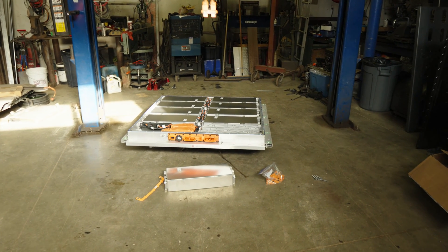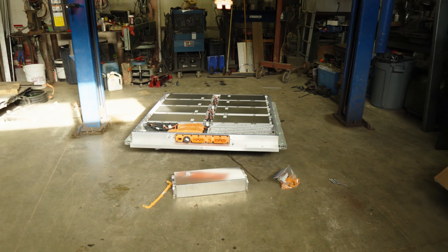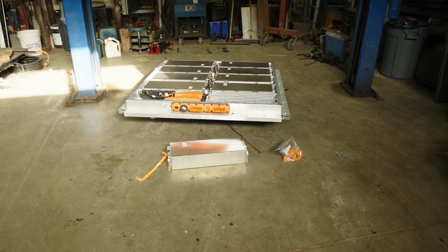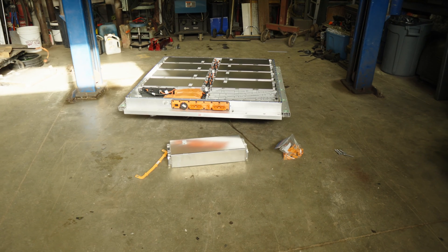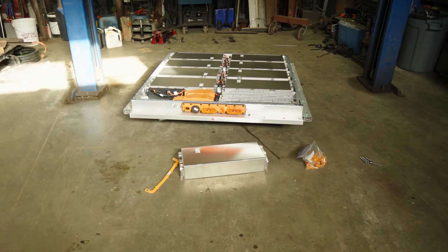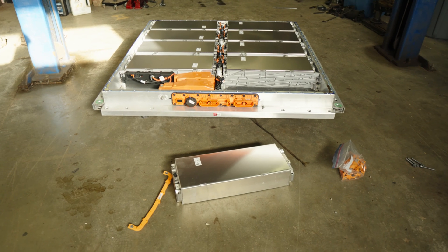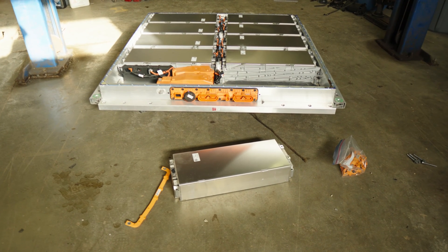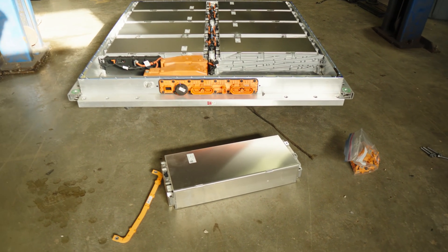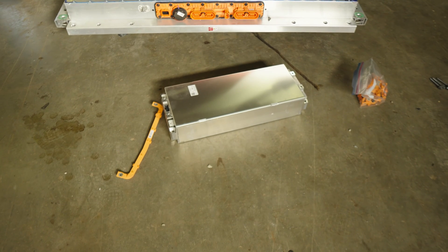I find myself in the same situation as always. I got this thing pushed into the shop and up on the hoist. I thought I'd just try a couple of bolts and see what I was in for — an hour later, the battery is sitting on the floor with the top off and I didn't record any of it. It was only about 24 fasteners around the perimeter and four going up through the center, coolant lines on the front, and high voltage connections at the back side of the battery. Literally an hour later, this thing is sitting on the floor.